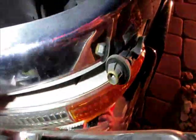This lower one, I was looking at it going, how the hell do you get that out? So you move the headlight as normal — it's caught on the cable over here, on the hood latch cable. I was looking at this parking light on the bottom going, how the heck does that come out? Real easy. There's a little tab right over there — you push that in, pull it out, and it locks in over there. That little tab has to go under this little plastic bracket. So you pull that out, you can sneak this light out and get to your connector right over there. Put that bulb in — it's a 194. So that's what we're going to put back in. It actually makes it easier too when you pull it all out. You can change those daylight running light bulbs a lot easier than the turn signal. But this one, you're definitely going to have to pull it out. 194 bulb in the corner and you can get your lights working.